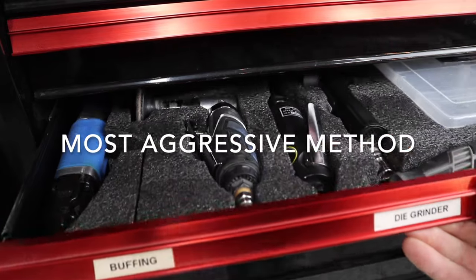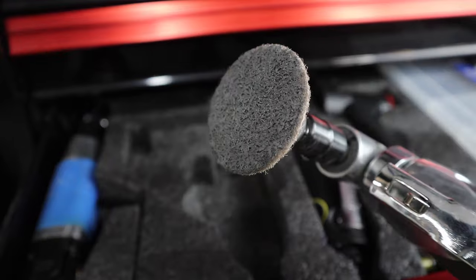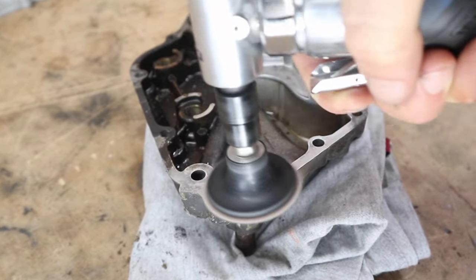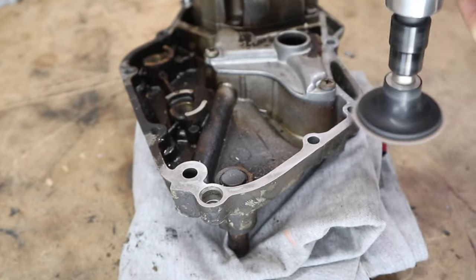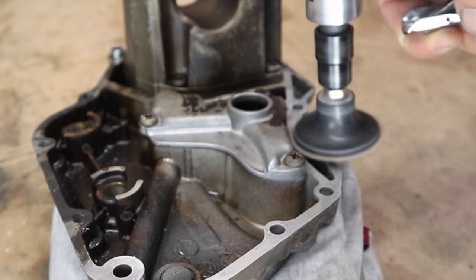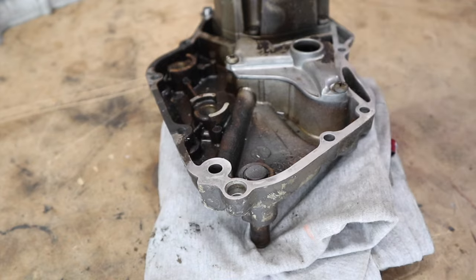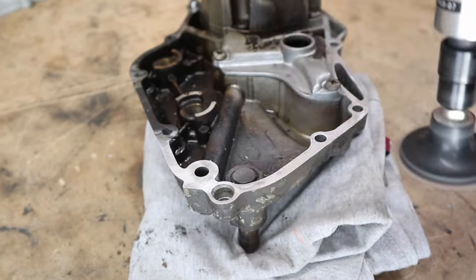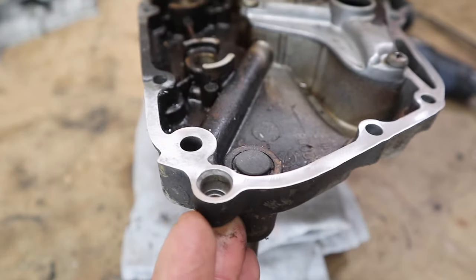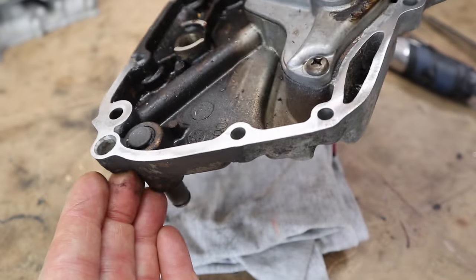The fastest but also the most aggressive way to take gaskets off — which I do not recommend unless you're quite experienced — is a die grinder with a Scotch-Brite disc. It can completely destroy the part in a very short amount of time if you're not careful. Not recommended by engine rebuilders, and probably something I shouldn't really recommend, but it can be done safely if you use a really old disc, take your time, don't press hard, work off the main bulk of the gasket, and then clean up with the finishing.